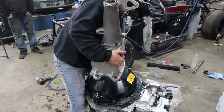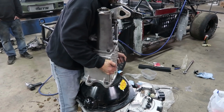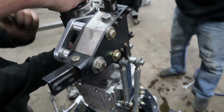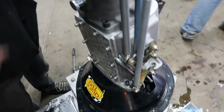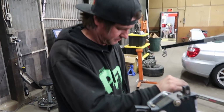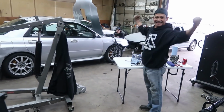Alright. Just like that, Phong turns around and grabs the transmission. So we ended up putting it in gear, twisting the shaft, get it to line up in the second disc. Now we've got a bolt right there that we can tighten. Then we can turn the transmission, tighten another one caddy corner. Yep. That's a big clutch alignment tool. Good thinking, Phong. Go Phong!